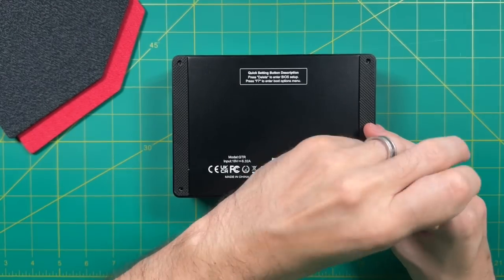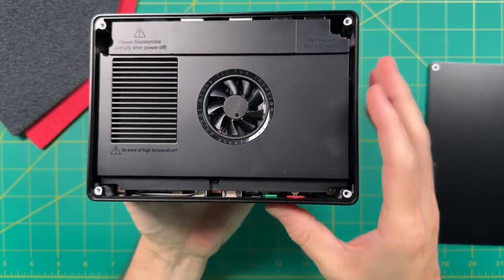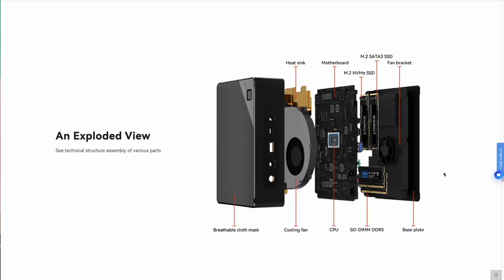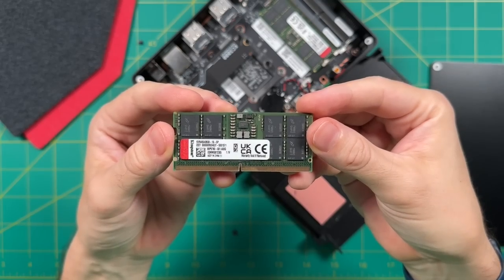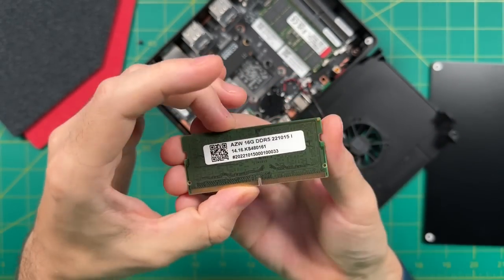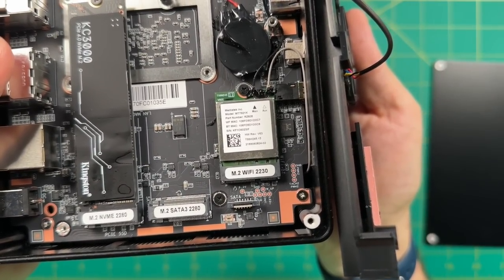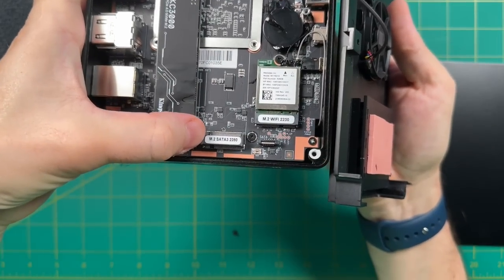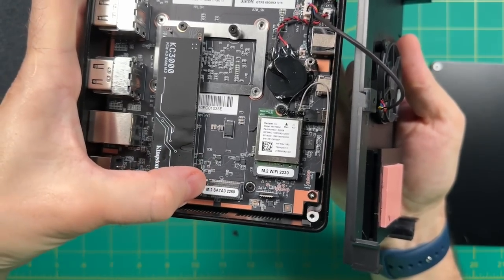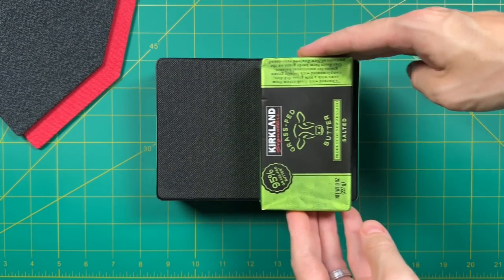Let's do a brief teardown to have a look inside. That rubber tab makes getting the cover off very easy. The first thing you may notice is that this thing is covered in fans and heatsinks on both sides — even on the bottom they are circulating air. The main heatsink is on top and the motherboard is sandwiched between two fans. To access the storage and RAM you need to remove a panel — just four screws. Inside we find Kingston-branded DDR5 RAM rated for 4800MHz, and a Kingston-branded M.2 2280 SSD. In addition to the PCIe 4.0 slot there's also a SATA 3 slot for additional storage, though there's no room for a 2.5-inch drive due to the extra heatsink and fan.